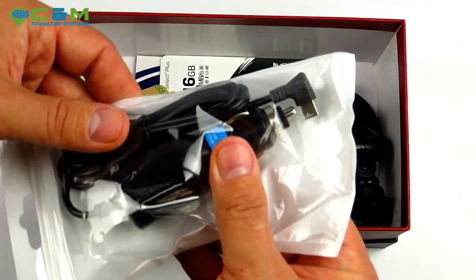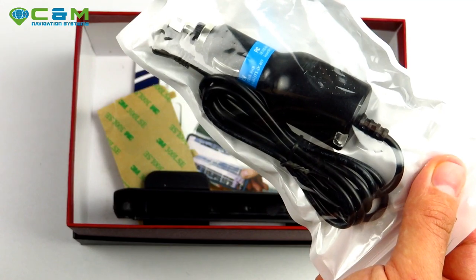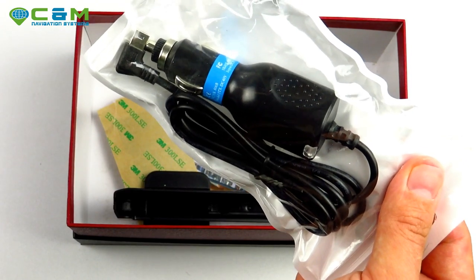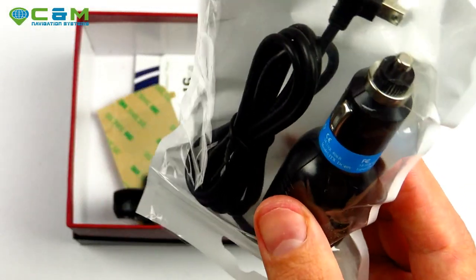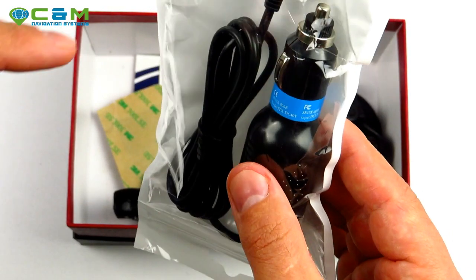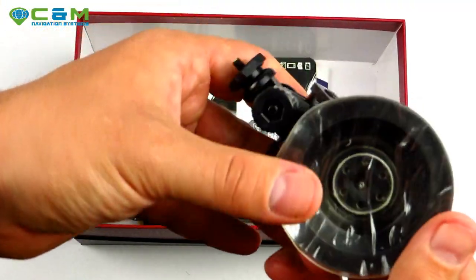A proper charger is this 12/24V charger. I insist on 'proper' because nowadays many people on eBay or other websites sell sat-navs without proper 24-volt chargers — even if they state it in their description, they're only good for a 12-volt socket. As soon as you plug it into a 24-volt socket it will just blow. This one also has a nice angled connection which keeps the wire straight down at 90 degrees so it won't snap easily or pull the sat-nav to one side.